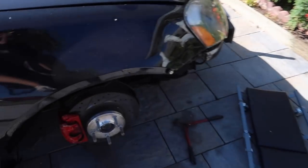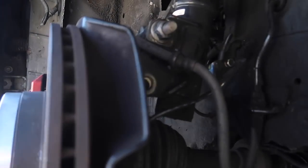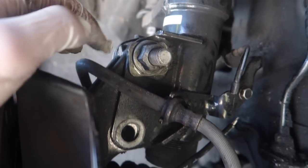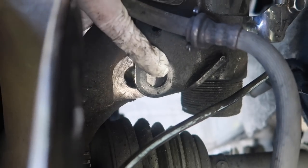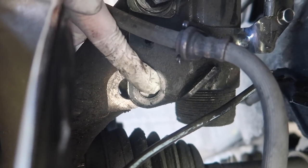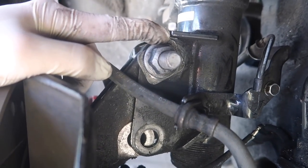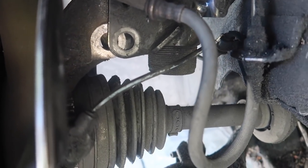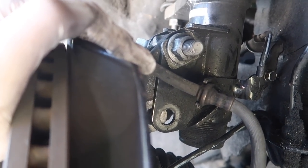So the wheel is off. My plan here — I slotted the top coil right there, just a little bit in, and I was able to get like about three more degrees camber. But my plan is to push it in like this and put a metal plate right here between these two holes. There'll be a bolt and a nut here and a bolt and a nut there to hold it on and give me more camber. I only slotted the top maybe like half an inch and it already gave me like three degrees.